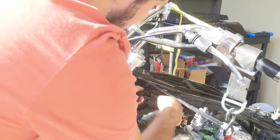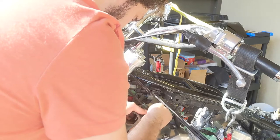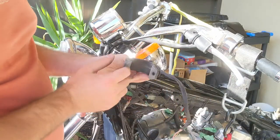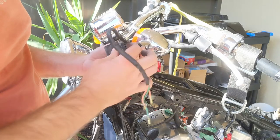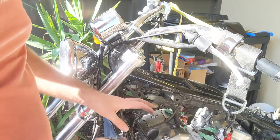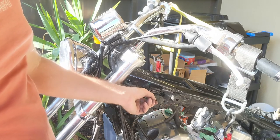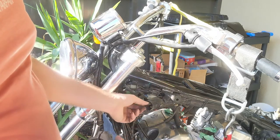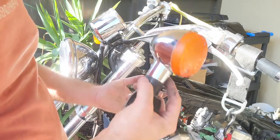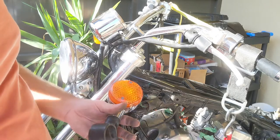As you can see, it's extremely dirty, and it got worse with the fire. You should have three wires — it's simple. You just need to remove the bolt that goes here and unplug the three wires and you're good to go. If you are going to be reusing the original wiring on the bike, make sure you take note of everything you're taking off. Tape the three wires and make sure you identify the right or left turn signal for the front or back.